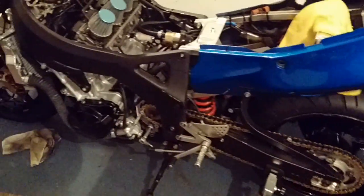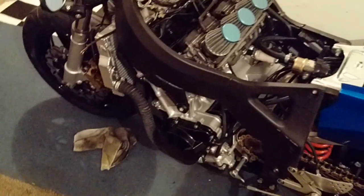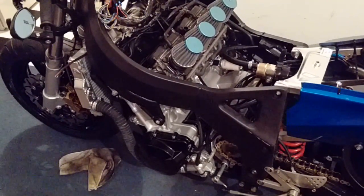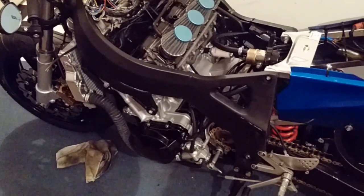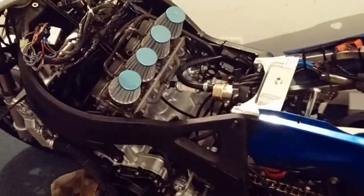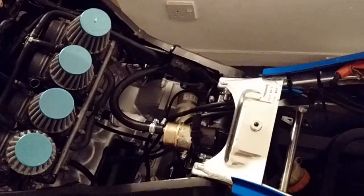The cooling system is now done. I filled it with antifreeze and I don't think it's leaking — there's a tiny drop coming from the radiator plug at the back which I've tightened up and it seems okay. New antifreeze tends to leak out anywhere it can anyway, so I'll probably just tighten that a bit more. That's the cooling system done, and then I started on the fuel system.